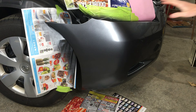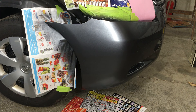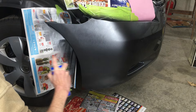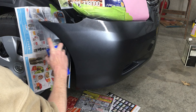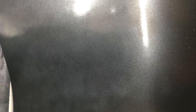I let the wet coat dry per the instructions on the can and next I'm going to apply the clear coat. But first, I need to clean the surface with a tack cloth — bet you thought I was going to say wax and grease remover! The tack cloth is just a tacky rag that grabs any dust on the surface and picks up fine contaminants that I can't even see with my eyes. Now it's time for clear. The clear is a lacquer, just like the color coats. Mixing lacquer and enamel aerosols can sometimes cause the paint to react funny and lift, so be sure to stick with one or the other. I'm doing a really light coat to start, then another light coat, and another light coat. Now it's time for that glossy wet coat — same as the color wet coat, go heavier but not heavy enough to cause a run. If you get a run, let it dry, wet sand it out up to 600 grit, and then pick back up with the clear coats. There's some orange peel but that's going to come out when I polish the area. Professional urethane paint self-levels much better than lacquer because lacquer paint starts to atomize or dry as soon as it leaves the nozzle, so it doesn't lay down as smooth. But I'm going to fix that later with the polishing compound.